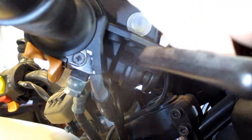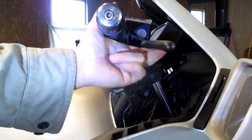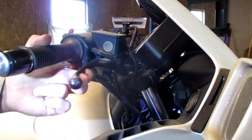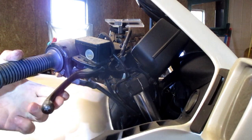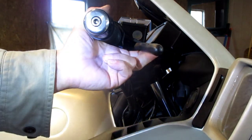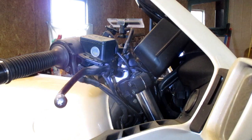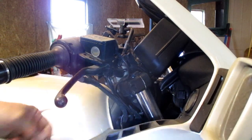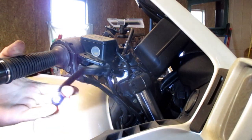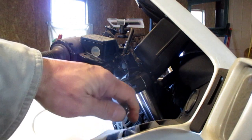You can see how the lever barely moves here, but if I turn the handlebars, it comes back. See, it can only go here — it's tight. Now it's not so tight. Now it's tight again. It was tight and then it relieved. What all this tells me is that these factory brake hoses have deteriorated. I bet there's little chunks of rubber inside. I'm going to have to get a brake hose kit for this bike as well.